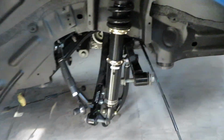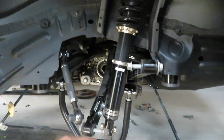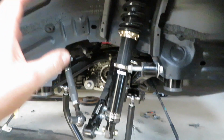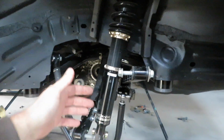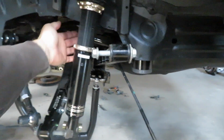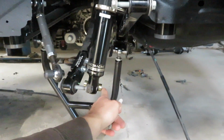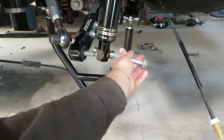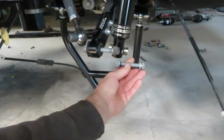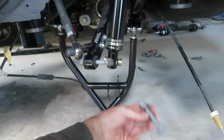So if you guys remember, I made rear true coilovers. So these are DS coilovers off of a Lexus made to work on the Charger. But the thing is, on the Chargers and Challengers, like I said before, this is a shock and then there's a spring separately. So there's gonna be more force on this coilover, and I wanted to have a larger bolt, which the Lexuses have, a 14 millimeter shank, 14 millimeter bolt. It just made sense. Instead of having, I believe, a 12 millimeter bolt that goes through the normal Charger and Challenger rear strut, or not strut, but shock.